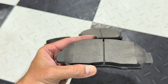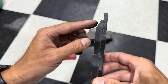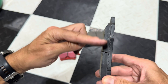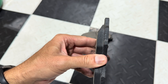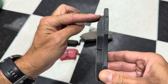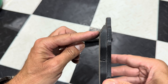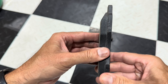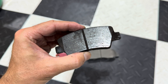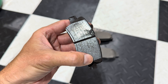If you do not have them on your brake pads and you want to add it, you always want to add it on the top part — the leading edge. The leading edge is the one that, if the rotor is rotating this way, gets hit first. So let's imagine the wheel is spinning and the rotor is going this way against it — the leading edge hits on this side first, and then as it's passing, that's your trailing edge. If you have brake pads that are squared off and you want to add the 45-degree chamfer, you definitely want to do it on the leading edge. You can do it on the trailing as well, but definitely on the leading one. And on this other brake pad, you'll notice this is our leading edge and you can see how the chamfer is cut larger than on the trailing edge — that's a smaller cut.